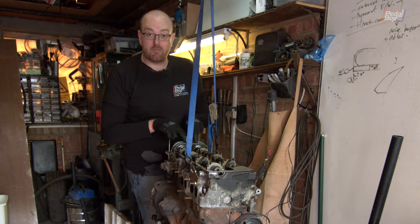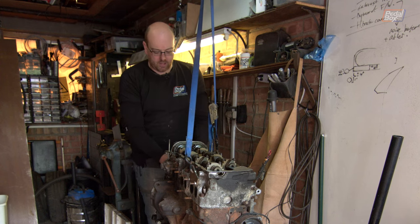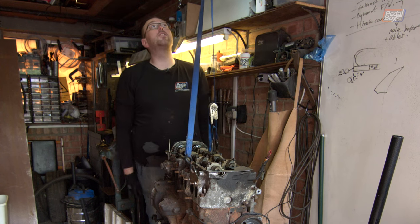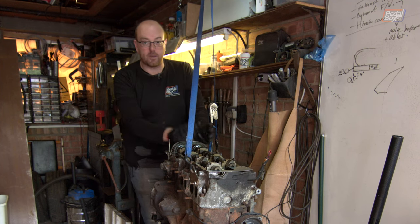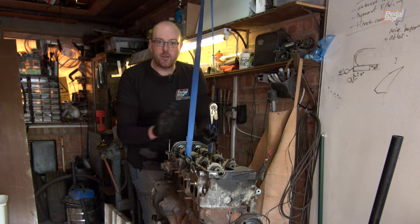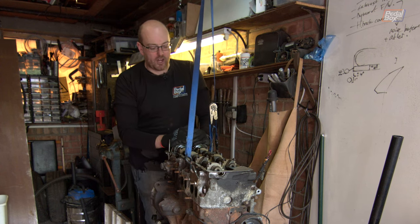In order to get the head off, I have to slacken these timing chains, and to do that I have to get into the panel on this end of the engine, which is currently blocked by an engine stand - not very convenient. I'm going to take the thermostat housing off probably as well, and I'll have to hold it strapped up and move things out of the way to get into the timing chains. Checking the guides was a good point raised by Crispy on the last video - thanks very much, I hadn't thought to do that. I also took all the remaining pipework off, all the electrics, the coil pack, and labelled them up so hopefully I can put this back together on my own.